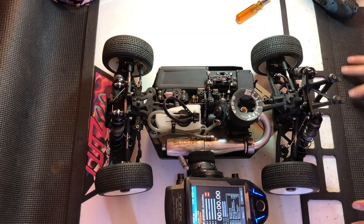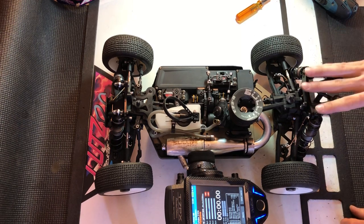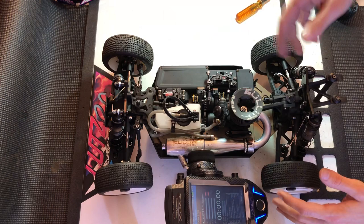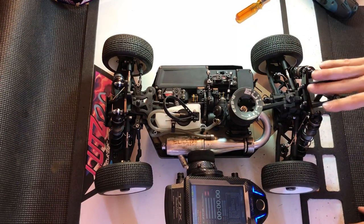Now the next question to ask is your end point — do you have enough brakes overall? That's something you're going to have to get used to, you're going to have to feel that. When you get on the track and you feel like your brakes are proper and they feel good, come back to the bench and do what we've just done and feel your bias. Get used to that pressure that you're feeling, and that's what you're going to want to set your brakes up as all the time.